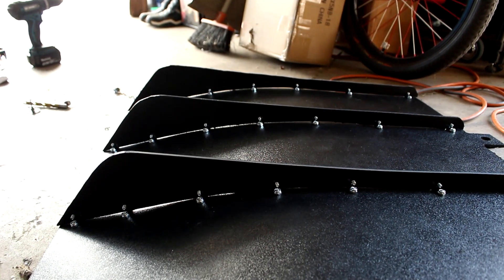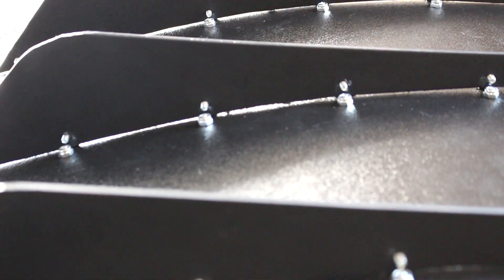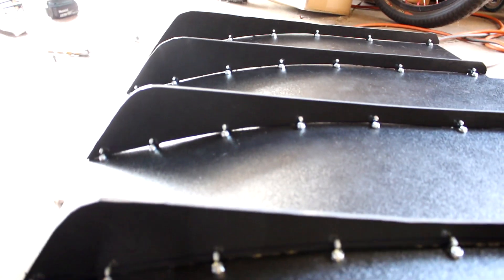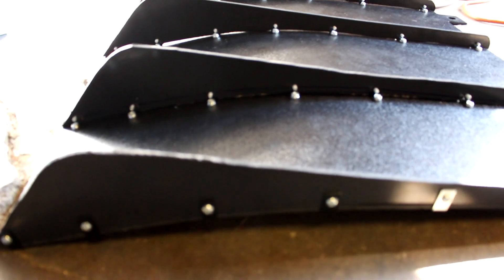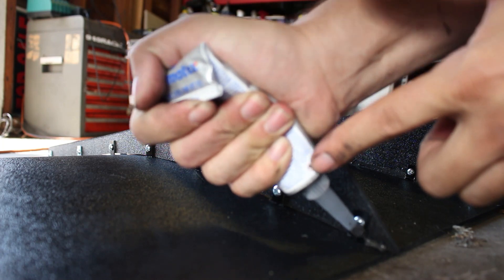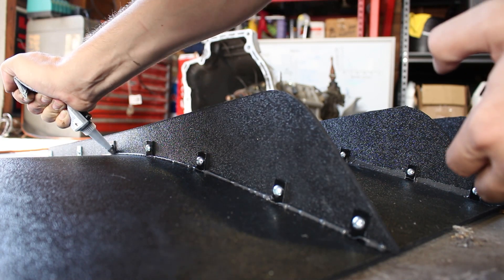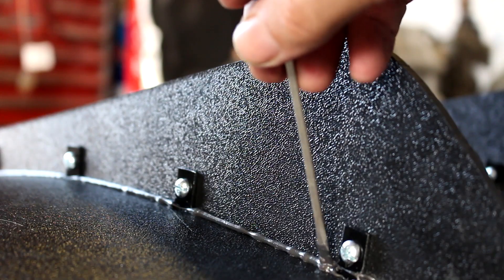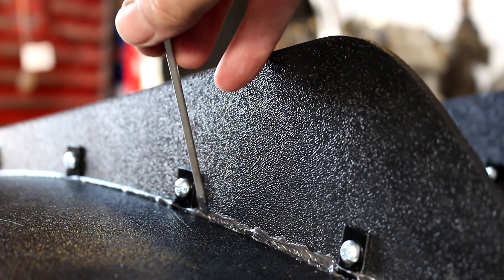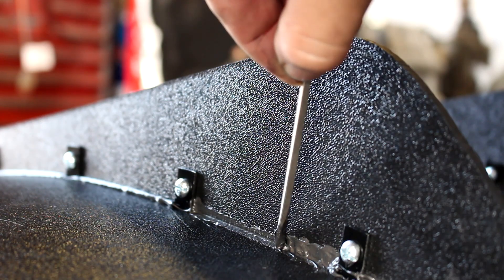This thing is basically built now but it needs some fine tuning. It looks extra bad because of the way I'm filming it and the light coming through the fins, but it does a good job illustrating the gaps. When you're cutting everything out by hand it's kind of hard to avoid this. So what you're going to do is take some black silicone and lay down a bead into that gap. Then take a flathead screwdriver and push the silicone into the gap and smooth it out — it honestly starts to look really good and pretty race car-like.